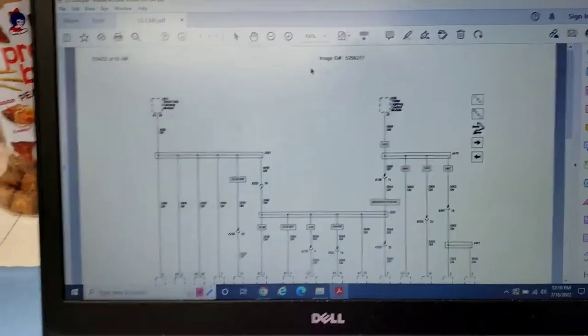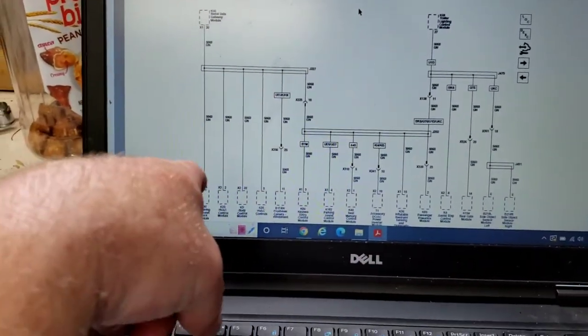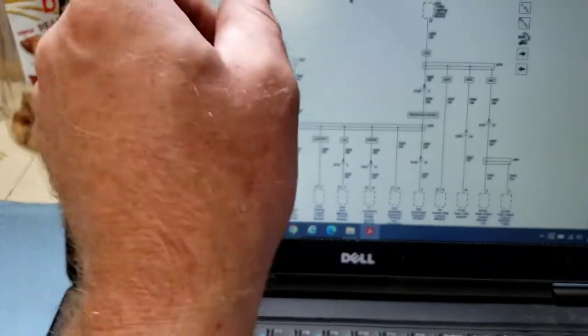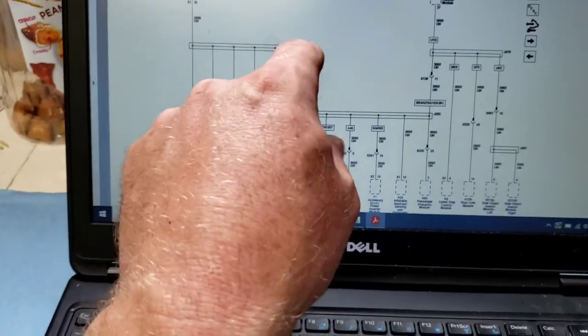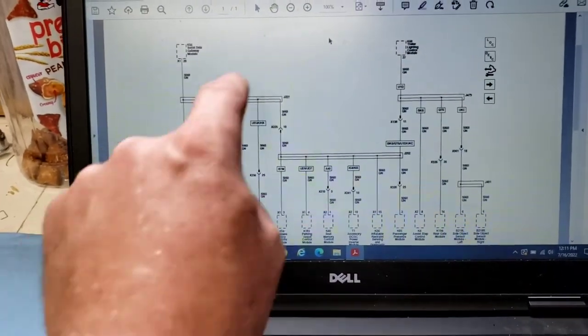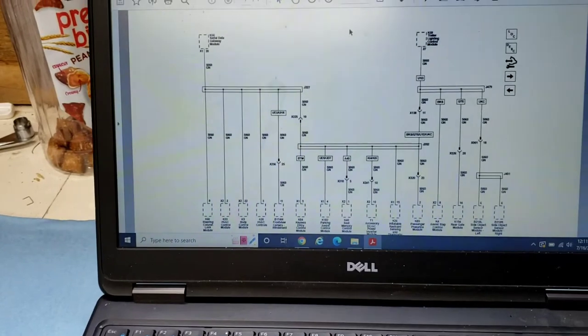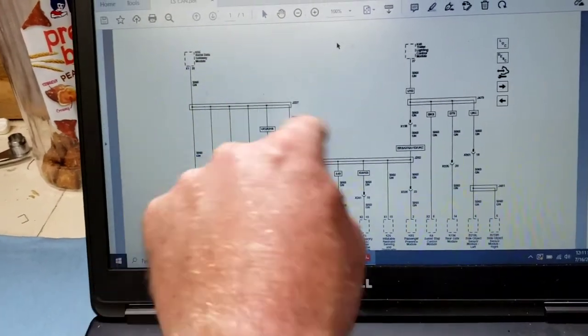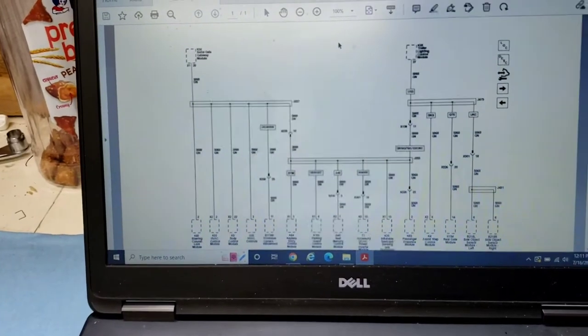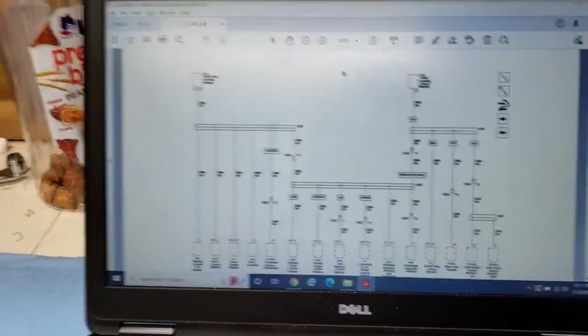But what I want to do is, in part three, we pulled fuses from each of these and nothing changed. We isolated joint connectors, well, not the connectors themselves, between them with these other X connectors. I want to get right to these joint connectors. I'm going to look up these joint connectors. I want to get to these before I do anything so I can unplug these modules one at a time while it's acting up. That is how I need to get to it.